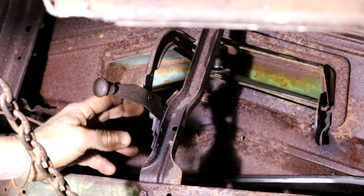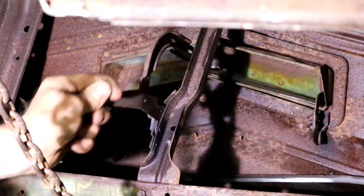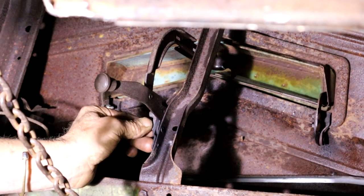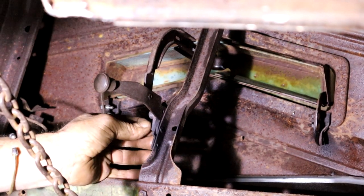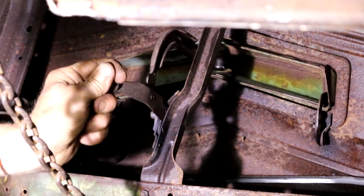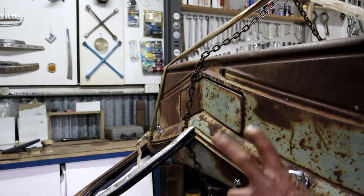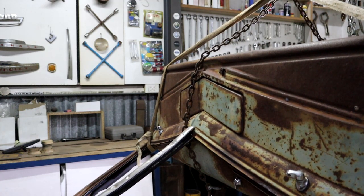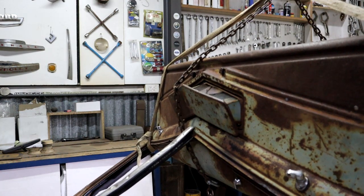So I spent quite a bit of time loosening up what we call the original aircon here - it's now working. The thing that really worked well for me is these hinge points were completely rusted and frozen. If you heat them up with the torch until they're red hot, they normally become loose. A little bit of oil and there we go. If you're not familiar with a 1950 Chevy aircon - see this flap here? No aircon at the moment. Pull the lever a little bit - that's half speed. Pull more - that's full speed. Of course this kind of aircon only works in warm places; in winter it will let you freeze to death.